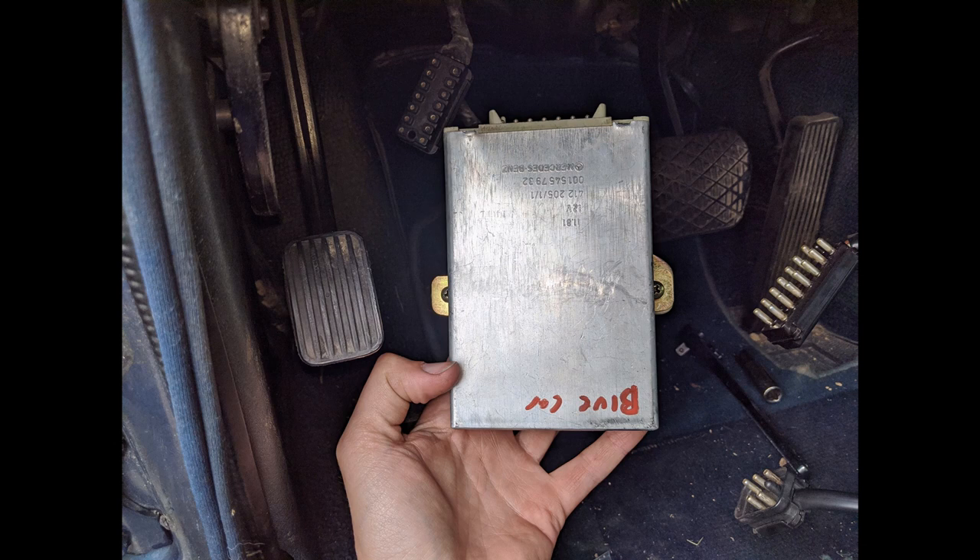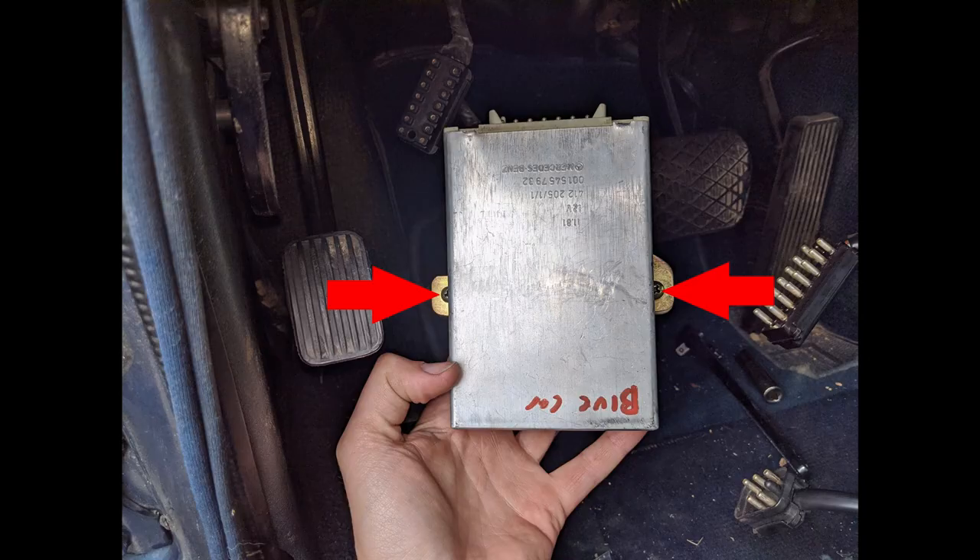Now, it's still going to be connected to that one wire. You can either remove the two Phillips screws on either side of it now that you have access to it, or you can flip it over, push down this little clip, and slide the wire off, just leaving the bracket connected. I personally removed the two Phillips screws because with the bracket out it was easy to get to, and then you don't have to be disconnecting 30-plus-year-old plastic connectors that could easily be broken.